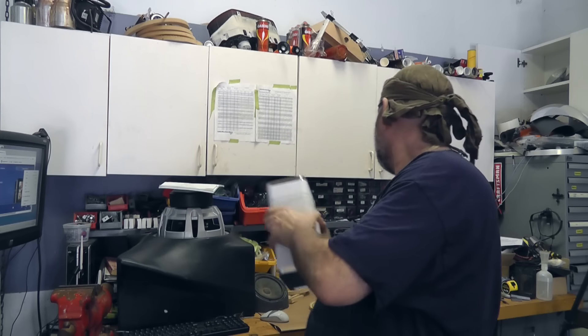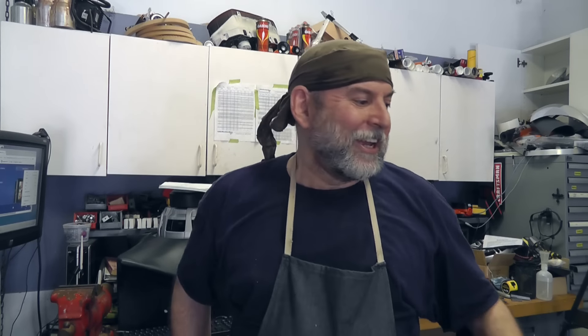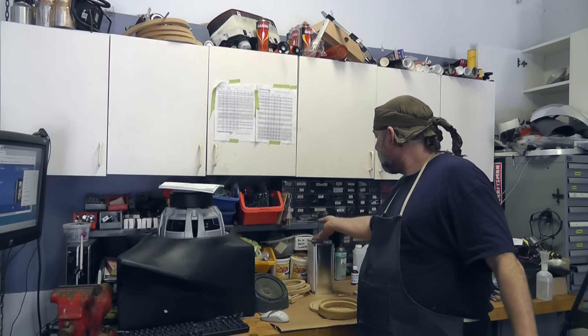The fiberglass resin has a limited shelf life — good for about 90 days. A lot of these have born-on dates. I even went to my local marina and the resin they had there — you couldn't tell how old it was. The good stuff is supposed to be red, by the way. A lot of what I know is from a guy named Robert Garza from Select Products. Based on what he said in his videos, red indicates it's a prime polyester resin. If you get it green, it means it's all the slop poured together — it's not even guaranteed to set up.